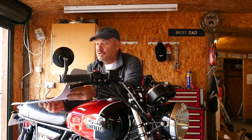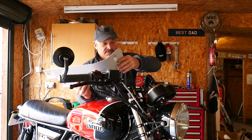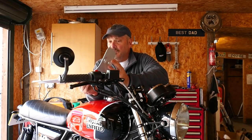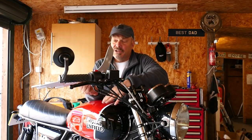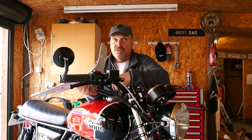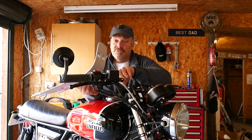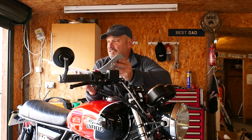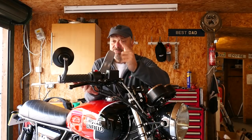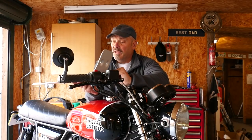Yes, it's quite a heavy-duty looking thing but it's a bit short at the front and the biggest problem is the actual way it fits onto the bike. The way they've designed the mounting brackets you've got to remove a lot of parts from the bike to actually fit it. You've got to take the full exhaust system off and you've got to loosen the frame rail mounting bolts off, and also the engine mounting bolts at the front you've got to take those out to fit the front mounting on. Yes it's a sturdy bit of kit but for the time involved and the shortness at the front, it lacks protection for the oil filter and the oil pipes at the front, and also it doesn't have any ventilation at the front to let air flow onto the motor.